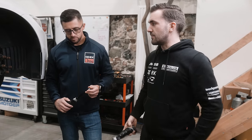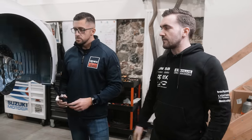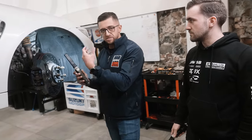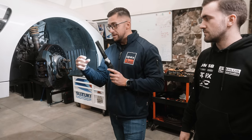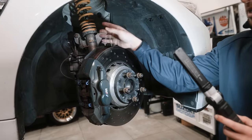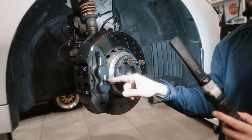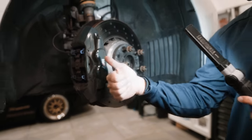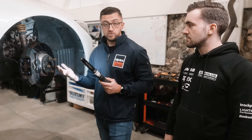The fluid is probably one of the most important things on a track car — you want to make sure it's always changed regularly with a good fluid. And in case you're wondering why the fluid boils: the brake system works by friction. When the brake pads press against the brake disc, they create lots and lots of heat, and that heat is transmitted throughout the whole system. You can even see that this brake caliper has changed color due to heat. So it is very important to change your brake fluid to avoid overboiling, and eventually pressing the brake pedal and nothing happening because your fluid has boiled.